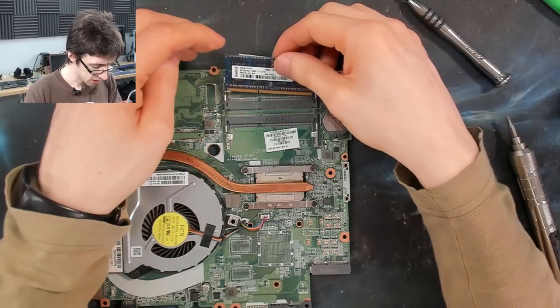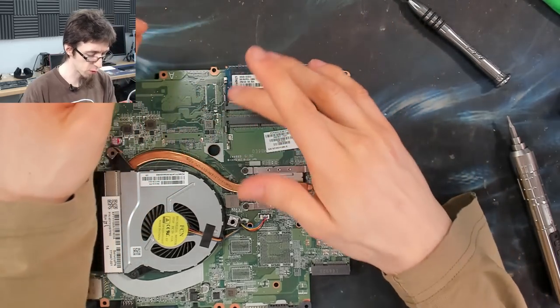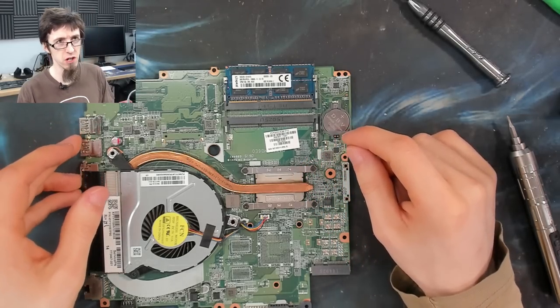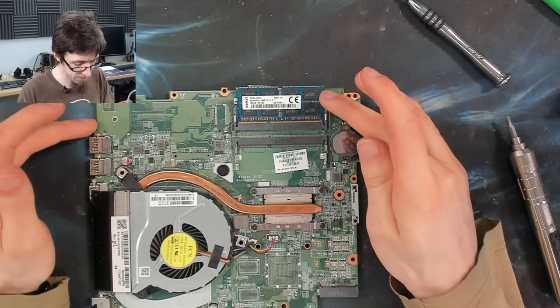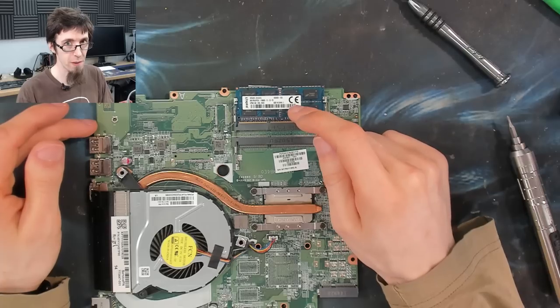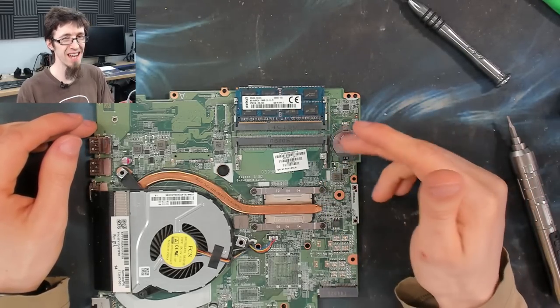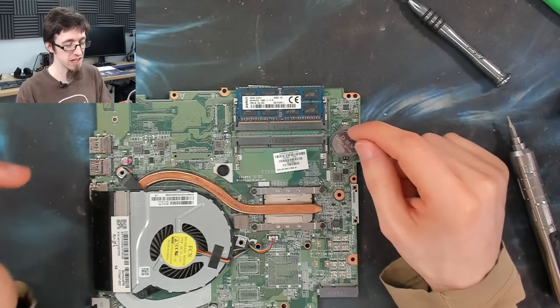No, never mind. I just had a look and I don't have a nice matched pair of 4 GB modules. I've got a couple of 4 GB modules that are DDR3 1.5 volts, or rather, this is DDR3L, low power. I've got some non-low power modules, but they're not matching. One of them's 10600 and the other one's 12800, which is what this is.